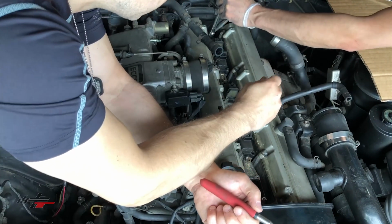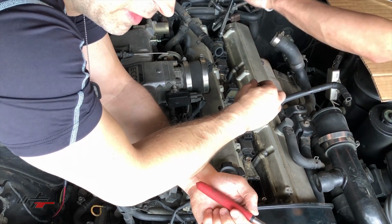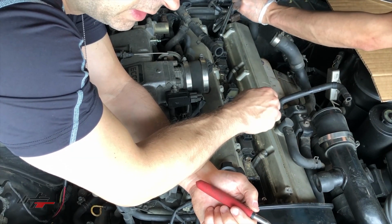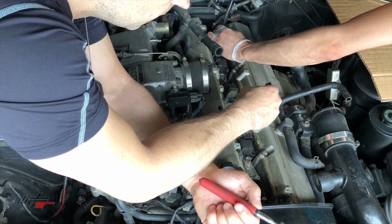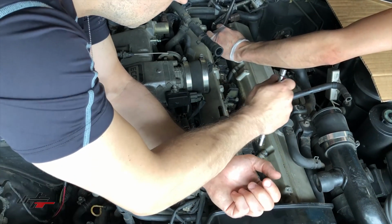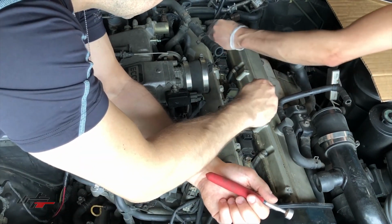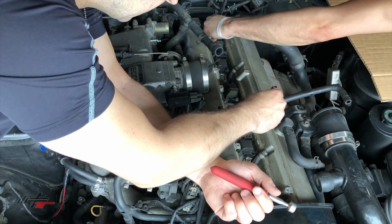Probably when your coils go out, the car will still run. It'll just start missing and misfiring a lot, especially on throttle change at medium to high RPM. Yeah, it kind of sounds like popcorn, or like a boxer engine almost. And my RB26 does the same exact thing. It's all these RB engines because they use the same coils and they all go bad in the same way.